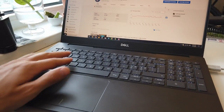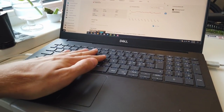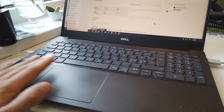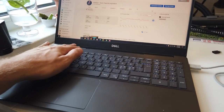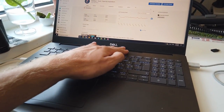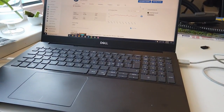The first thing I think you should do is to just touch your laptop at the areas where you're actually using it. So usually that would be on the keyboard area, the palm rest, or the touchpad area. If any of those areas are really hot to the touch, you know that you definitely need to do something about your laptop's temperatures. I also recommend you to touch the area below the screen because usually that area is significantly hotter than the keyboard or touchpad area.